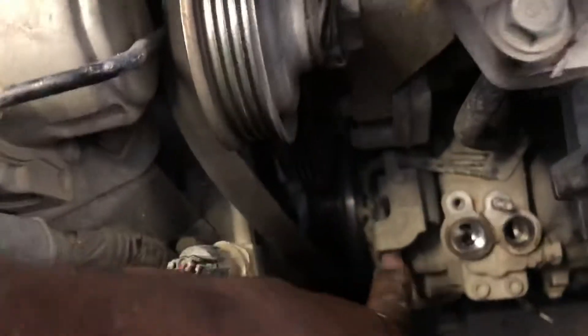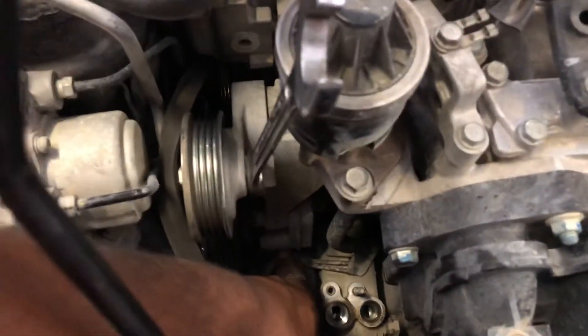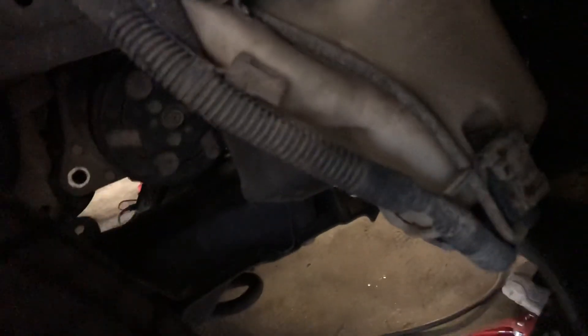Get the wire — this is the cable down there, just fish it all the way down. Then you got a 14mm bolt right here, another 14mm on the other side of the compressor down there, and then you got a wire harness clip right here. Come over here under the passenger side wheel well and you got another 14mm bolt right there. All you have to do is pry on the AC compressor — get a pry bar, pry on it right here and pull it out. The AC compressor is going to have to come out this bottom side right here.